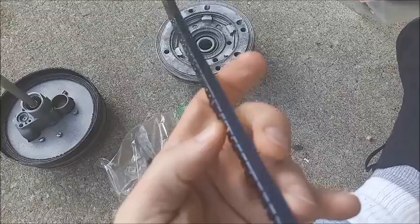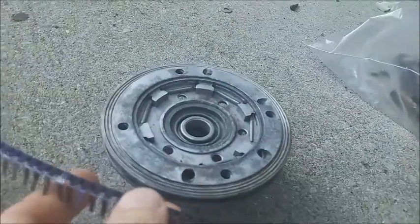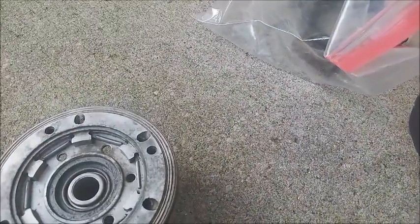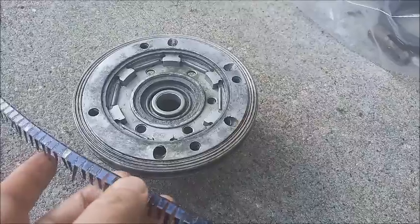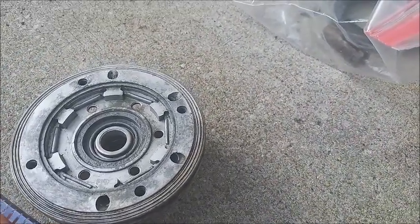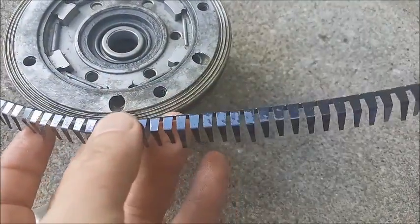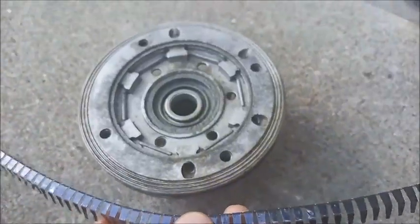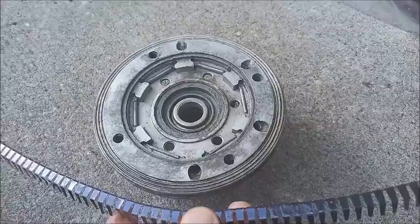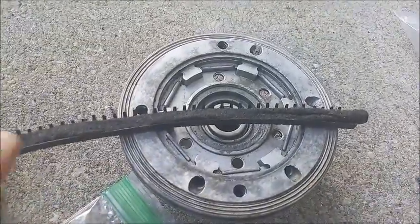The Delco Moraine retainer is like this, and it's this piece where my middle finger is rubbing that goes inside the groove, into the back wall of the groove, and these other parts of the teeth against the upper part, and then the teeth come off the outside with the wick inside. You just wrap it around the piston. So there's the wick in there.